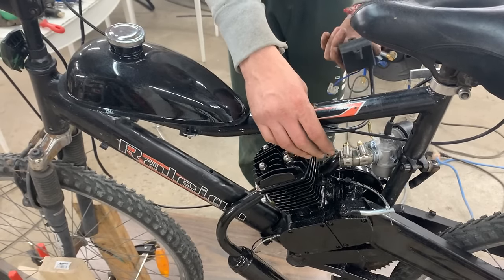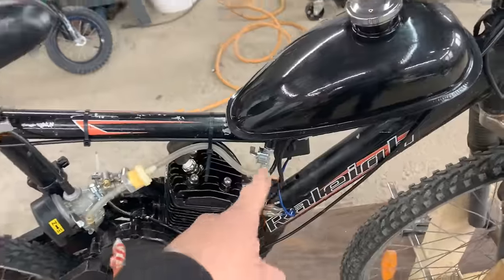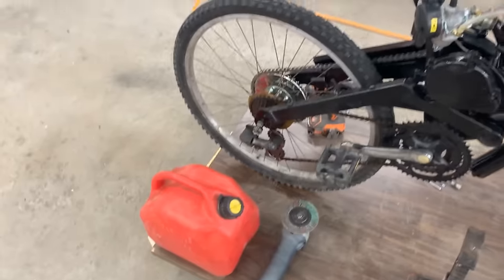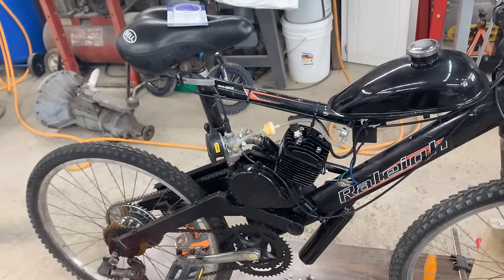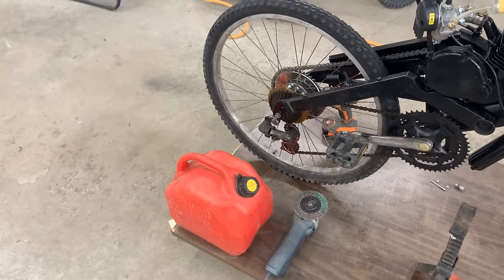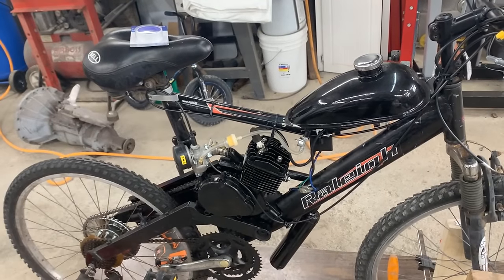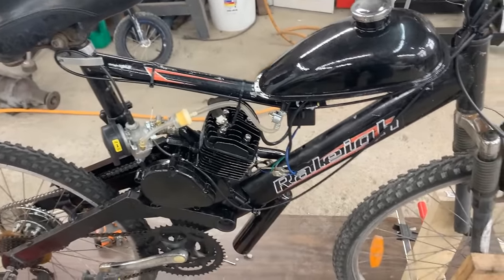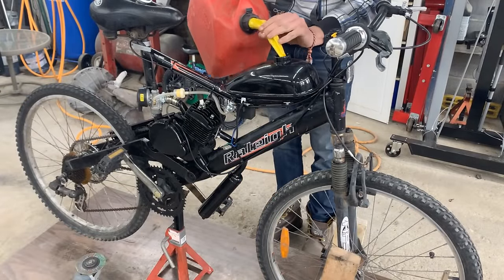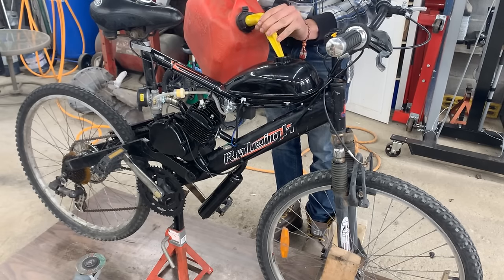Alright, so it's the next day and I got plumber's tape, so we're going to seal here. I also got fuel. It's non-ethanol, which is the fuel that's recommended for small engines. We just need to mix it with two-stroke oil. We'll find the right ratio and do our premix. We're going to pour it and then we're going to be ready to start it. I'm going to isolate this as well. So it is premixed, and that should be enough as a beginning.